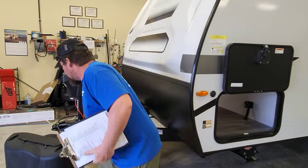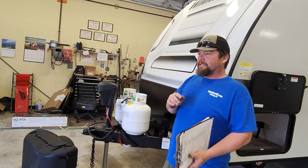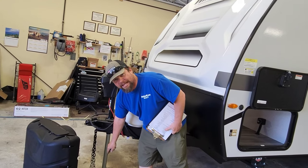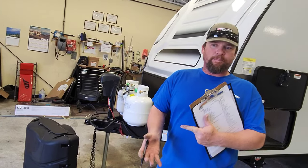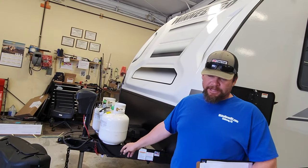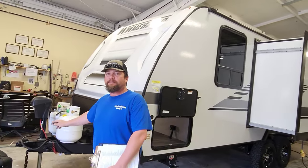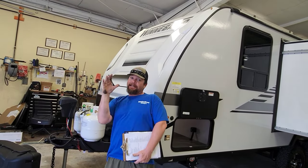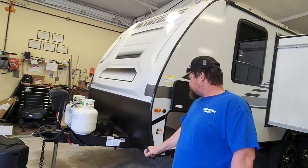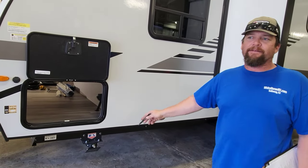Let me clarify some things about leveling. When you're camping, you want to level your trailer — a level trailer means a good night's sleep, and a non-level trailer means a terrible one. With this tongue jack, you want to put some spacers underneath that foot — blocks of wood or plastic. That way you can always get more height out of your trailer. This jack is just about maxed out right now, so if you were on a hill and needed to get the tongue higher, you'd need more space under it. Get some blocks right away and use them under that jack no matter what — four or five inches or so. Same thing with blocks for the stabilizers, because you never know what kind of ground you'll be on. Blocks are your friend.